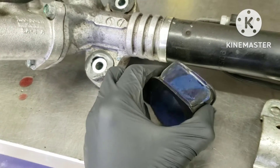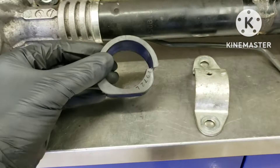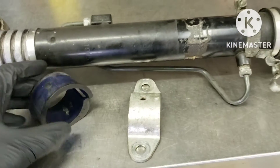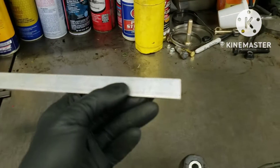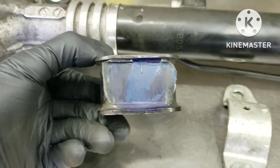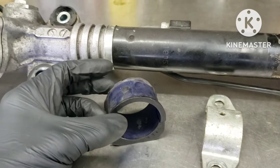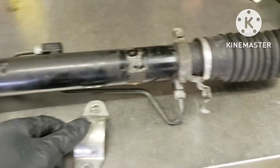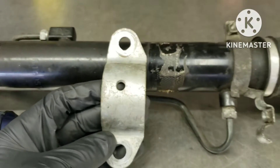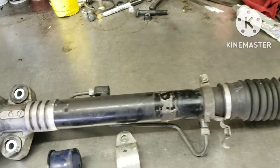It's a flat bottom, as you can see there, and then a circle mount for the rack. Now this is only a decent solution because after you put this bushing in the rack will still have slop up and down, which obviously you don't want. So you have to take a piece of metal and machine it down to about 90 thousandths to put underneath — that's what that gunk on there is. I actually used some RTV silicone to hold it all together to take up the slack. But then the bracket is a little bit wider than the bushing so you actually have to remove the ridge on the right side. So it's a solution, but it's not a good solution.